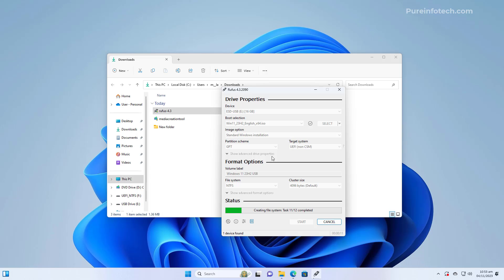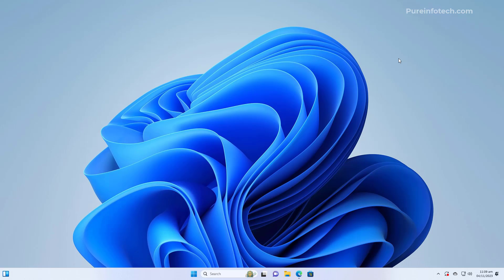To create the bootable media, click OK, then click OK again. The tool will erase the drive, create the necessary partitions, and transfer all the installation files. Like with the Media Creation Tool, leave the USB flash drive on the computer if that's the device you're upgrading, or connect it to the target device and reboot to start setup. Make sure the device can boot from USB — change those settings from the BIOS if needed, checking your manufacturer's support website. Usually you just press a function key or the Delete key on startup to enter BIOS. After the process completes, close the application and restart the computer to start the installation.